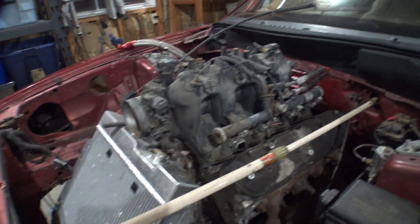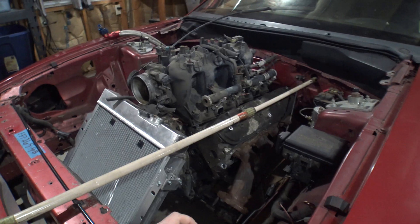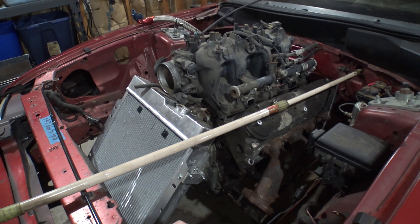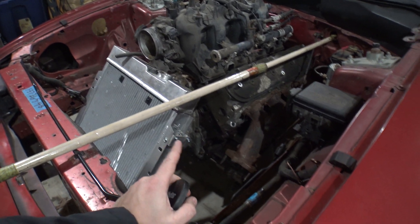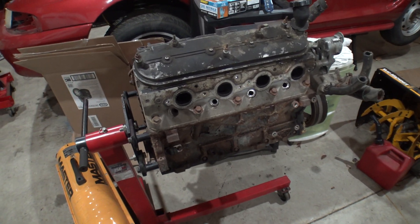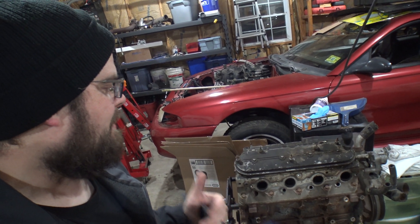Anyway, that fits. That's slug number two. That's slug number one. I'm just exchanging this guy for this guy at the junkyard, basically. I'm going to take this one apart, make sure everything's good, and use whatever I need off of this. I'm going to take the intake and some of the accessory stuff and get this guy rolling. We will tear into this guy and gap the rings also. Normally I don't touch these things, I don't open them up at all. But since we are going for a fairly high amount of horsepower, I'm going to open it up and open the rings.